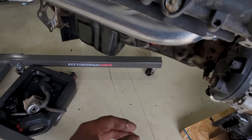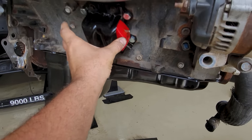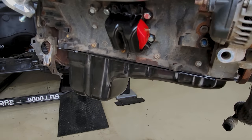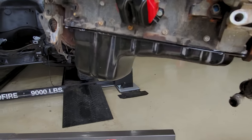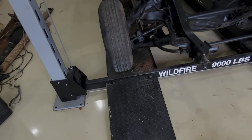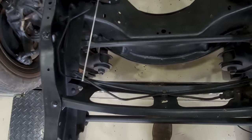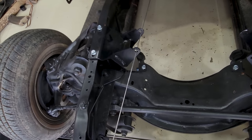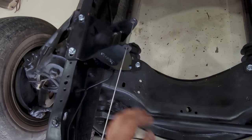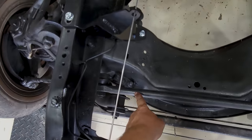Problem is, when I get the tape measure out and did a bunch of math, back of the polyurethane forward, front of the polyurethane forward, center bolt down, standoff down. Any way that I measured it, the total length of this standoff was going to hit the suspension steering components right here. And I can lay this welding rod through and measure from the bottom of the eyelet, or just add an eighth of an inch and get a true measurement. And no matter how I cut it, we're going to be an eighth of an inch short and rubbing against this.